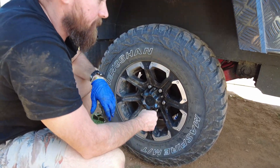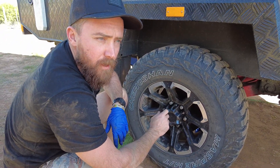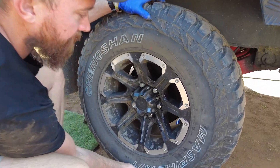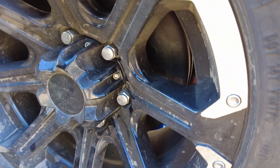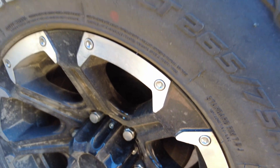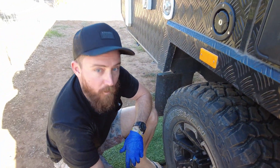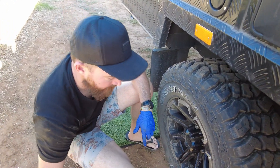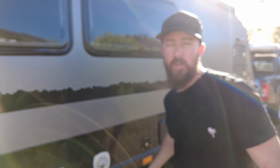There's a bit of wobble on this side. This one's a bit better than the left side, but I'm still going to take it off and have a look. I'll probably just do that castle nut up just slightly. There's a bit of wobble in there, just ever so slightly — that's not horrible, but it's not great. It's only going to get worse, so I'll just tighten it up and make sure it's all good.